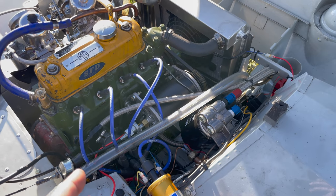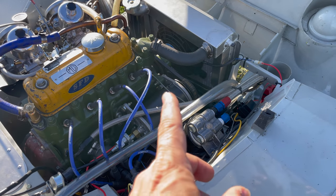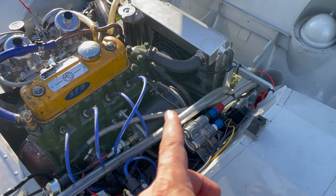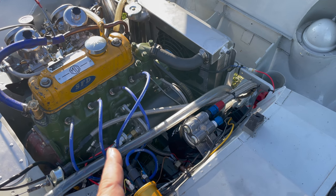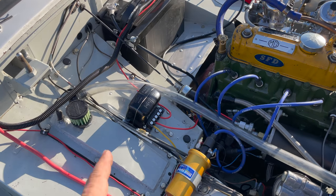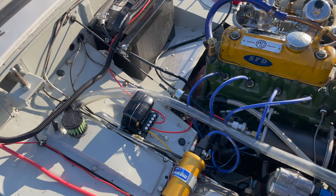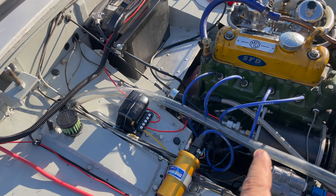The way this car was being raced previously, you had to recharge the battery in between each run as there was no charging system. The belt just did a continuous loop from the crankshaft to the water pump pulley. I was racing it with a generator fitted but I didn't have it connected to anything. Here I have fitted a dynamator, which is a tiny alternator inside an original-looking generator casing — I wanted to keep this car looking as stock as possible. I've also fitted an 8-inch electric fan behind the radiator. This looks like a voltage regulator but it's actually just a dummy box. Inside it is a 50-amp fuse that connects the wire to the two terminals, providing a place to plug in all your original wires if you want to keep your car looking original while using an alternator.